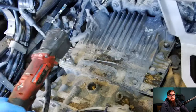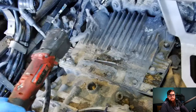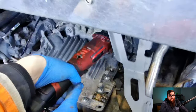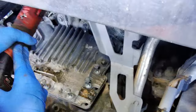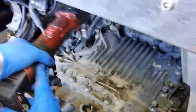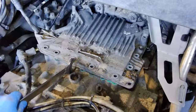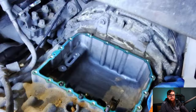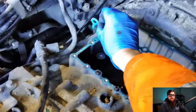We can now get this modulator off the gearbox — about 20 M8 bolts secure it. The only thing to bear in mind is trying to get this off square, as you'll need to transfer the measurements to the actuator pistons for refitment. These little springs at the front are detent springs — try not to pull them out when removing the old gasket, as if they fall into the gearbox or onto the floor they tend to grow legs and run off.